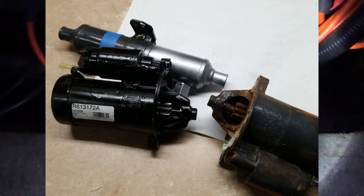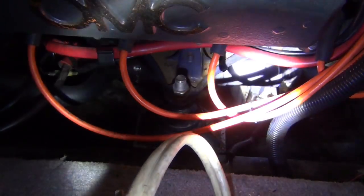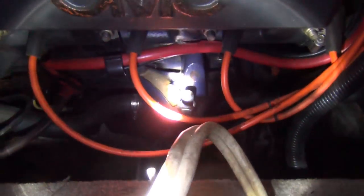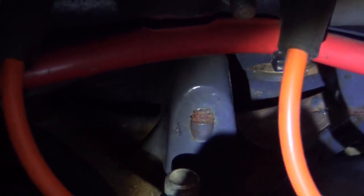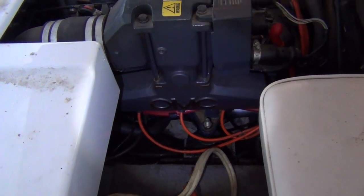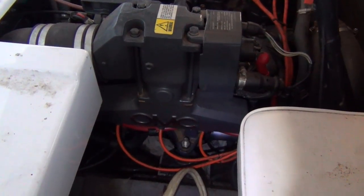Where that is, is underneath the motor mount — see, this is the motor mount right here. This cylinder right here is the aforementioned. This end of it was blown off because it froze. I looked at it and was like, man, it's not rusted, it's not that bad. And you look underneath it here, you can see there's freeze plugs that got blown out — you can see that one right there is a brassy one. Look at the little gap between right here and right here — it's so tiny, and that's where you have to work in to get a freeze plug in. Doing freeze plugs on an engine that's pulled out can be a little tricky, but trying to do it in a boat installed when you've just got that tiny little gap...